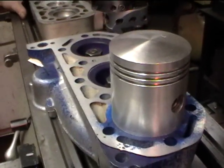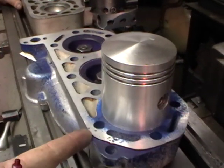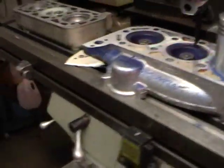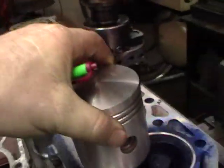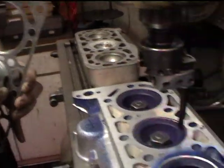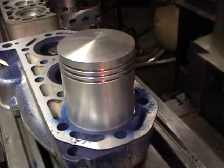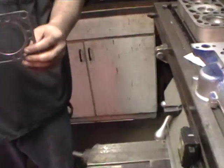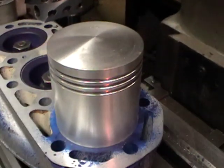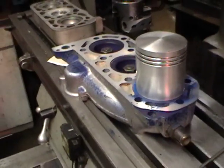Standard bore size is 71 millimeters, so if you go with a 71.5 — and a lot of guys are using 71.5 now — you've got to make your head bigger. You also need a bigger head gasket. Here's a stock head gasket: you can see it doesn't fit. Here's a 74 millimeter head gasket and those fit in there nice and easy. The head and the head gasket both have to be relieved, otherwise you'll bolt it together, spin it over, and it's going to lock up on the first rotation. You might get lucky and the head gasket may give you just enough clearance, but you will have trouble at higher RPM. Be sure and do that anytime you exceed 71 millimeters.